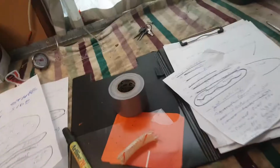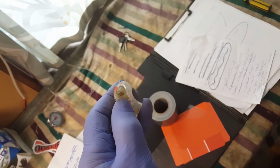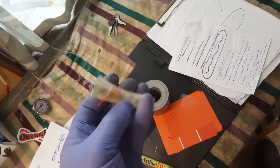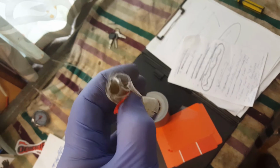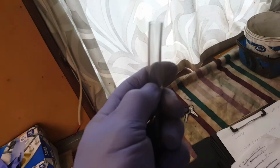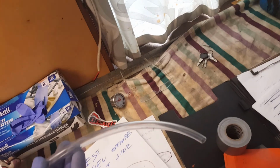When I'm talking about being careful what hose you buy for running tests, this is an example. This is a piece of hose I got for running tests, and we see here there's hose within hose, or a protective layer. So that was fuel affected, and also I think that it sort of twisted. It was much more flexible before it got fuel in it, and since then it's become very hard. What I found with this fuel line was when I put a clamp on it, it would spring a leak, so it was leaking everywhere, and you don't want fuel leaking near an engine.